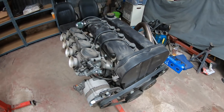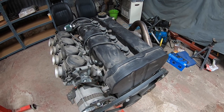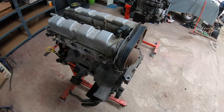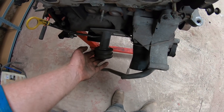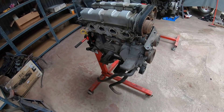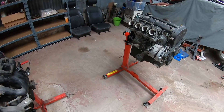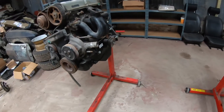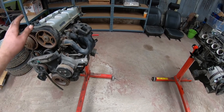So I have one rear-wheel drive converted ZTEC blacktop two litre with bike carbs, and one ST170 that is going into my Mark II Escort — it already has the mounts and stuff on it from where I've been trial fitting. The goal for today is to swap the sumps over. There's a Neil Dunn sump on the ST and a CVH sump on the other one, so I'll put the Neil Dunn sump on the ST170.